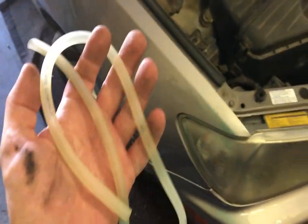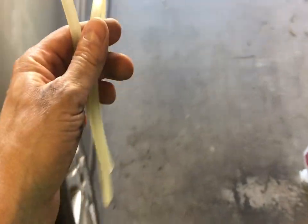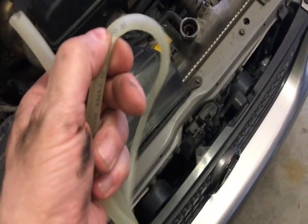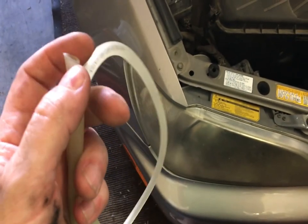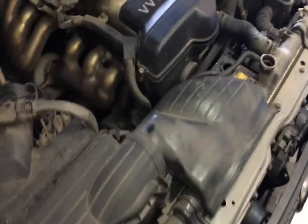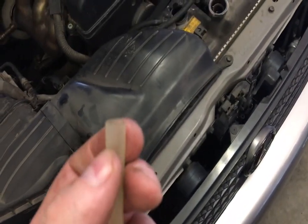So we're about to drain the heater core. The spigot this runs from is going to be three-eighths inch, so I just bought some stretchy vinyl tubing here. It's a little expensive — I think I paid about three dollars something a foot and I got three feet. This is sort of what lack of planning gets you, but you still save a lot of money compared to taking it to the shop. This will just fit over the end and we'll snake that down into a pan beneath the car. There's a bolt back here — it's 14 millimeters — that we're going to loosen after we attach this and we'll drain the core.